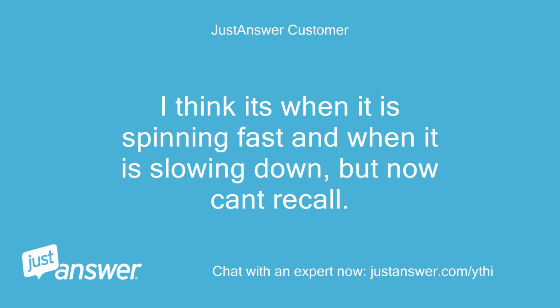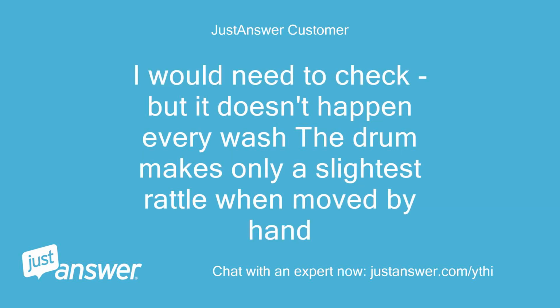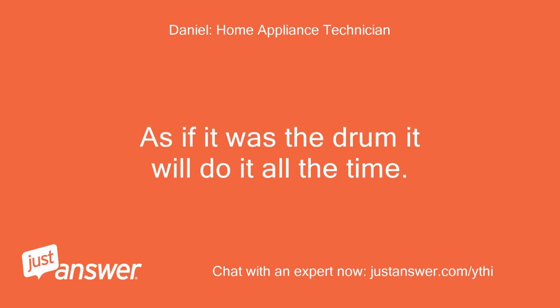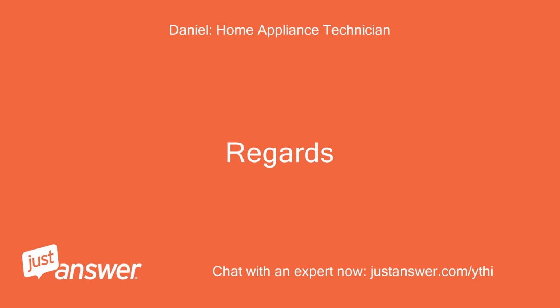I think it's when it is spinning fast and when it is slowing down, but now can't recall. I think it's when it makes a whir noise as opposed to spinning. I would need to check, but it doesn't happen every wash. The drum makes only the slightest rattle when moved by hand. Hi, okay, I think it could be a fault on the pump. As if it was the drum, it will do it all the time. Whereas a pump can play up, and this could be why it's showing the E06 error code as well. Regards.